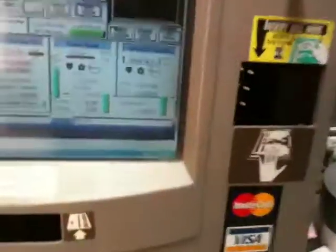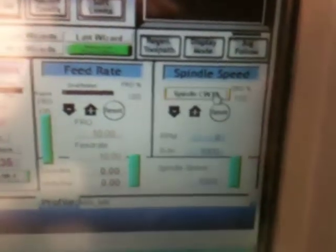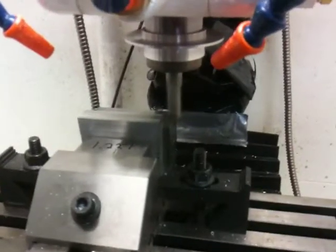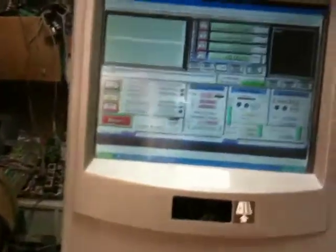We can go over here and type in what we want — 1000 — and turn it on. There it is, running. We got the TAC sensor hooked up too. I haven't calibrated it yet, but we're at about 870 RPMs when we command 1000. So I've got to even it out a little bit better and map it.